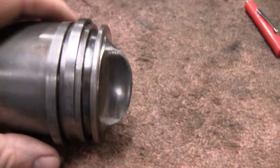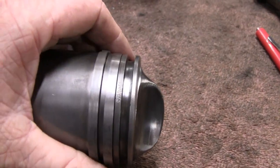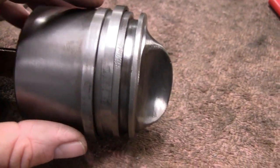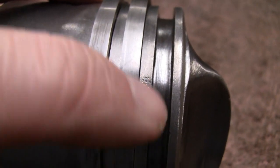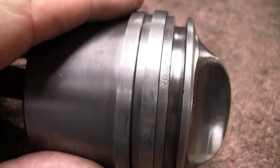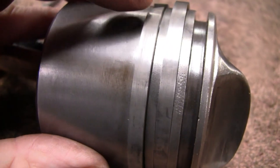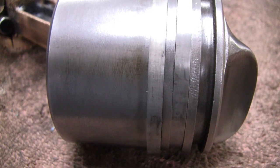Alright. You see the way these rings here are nice and loose? They're not sloppy, but they're loose. That's the way they should be. And that top one wasn't. So you have to further review. This whole piston is pristine, except for this one area. Let it focus in. Okay, you see that? I don't know if this was in a vise at one time, because you also have a little nick over here, and it's odd that they're both opposed. And like I say, maybe at one time it was in a vise or someone dropped it or something, but assuming that's where our binding up is. So I'm going to address that with a file, and we should be all right.